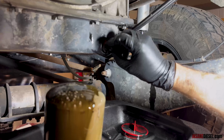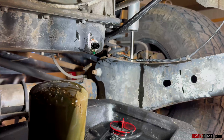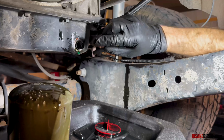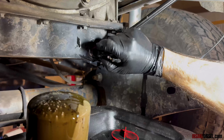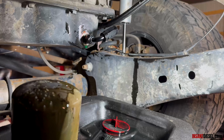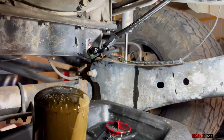So if you so choose, this is the fitting oil pan adapter for your oil pan. And you would take the hose from your return side of the line and just run it right here. Just need two little short hoses with a 90-degree fitting. Like this. That would go to your return hose that would go right up here and over to your housing. Two short little hoses, and you can return to the oil pan instead.